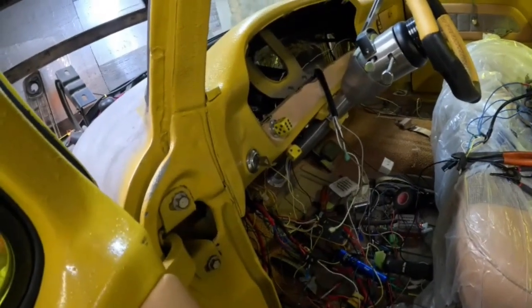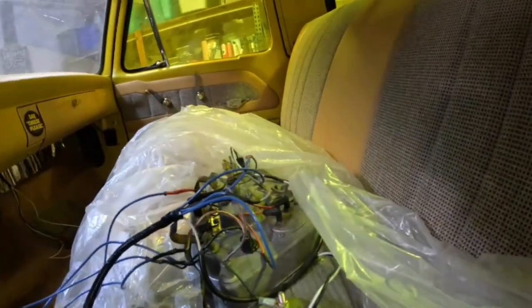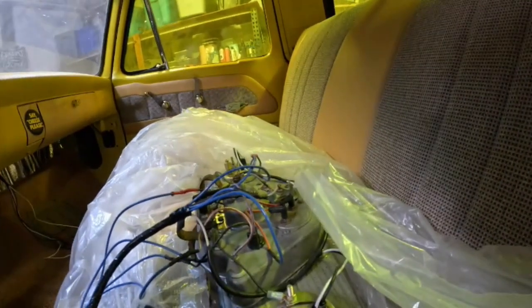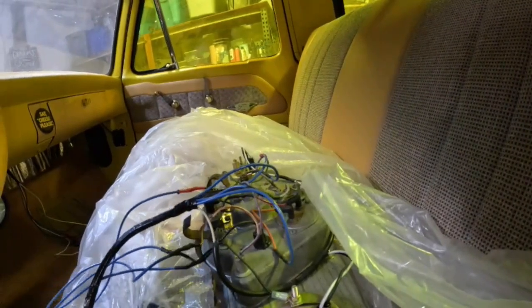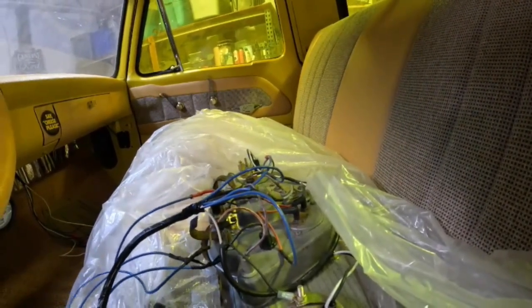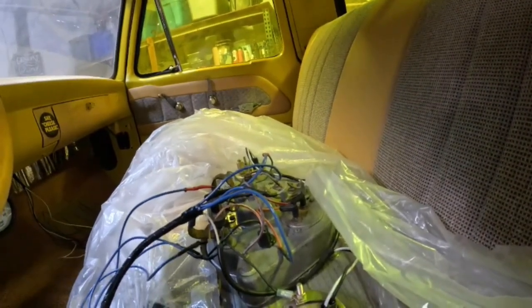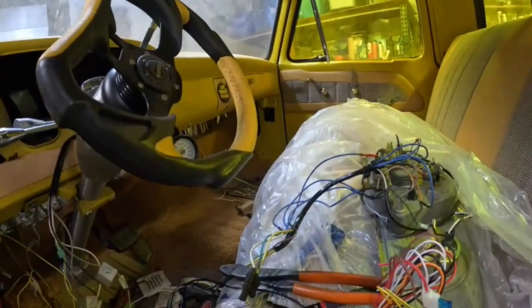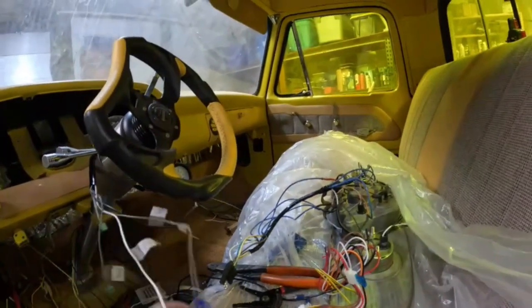For plug number 2, it is right and left turn indicators on the gauge cluster and the charge indicator. So one charge indicator goes to that, one goes out to the alternator, and one goes to each front turn signal. So we're gonna get started on all that stuff so we can get this gauge cluster in here and get this tack wired up.